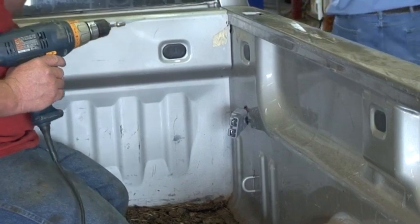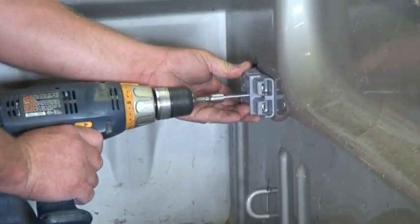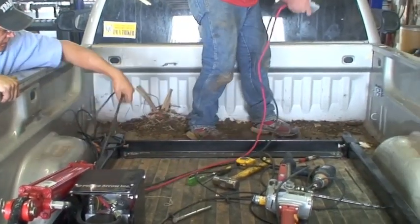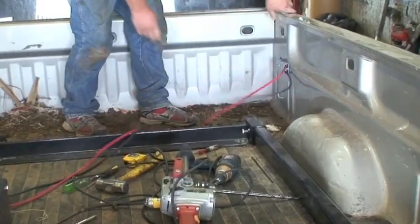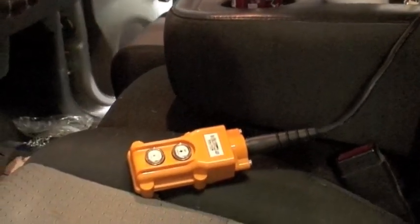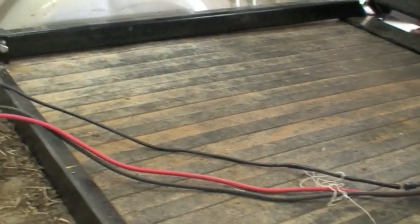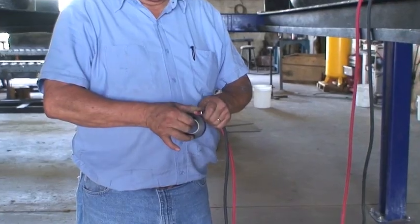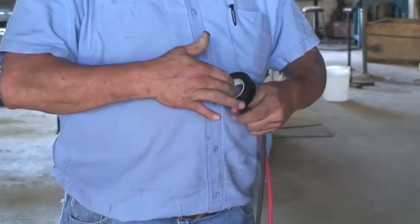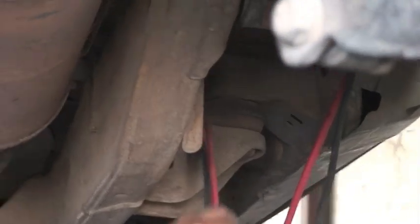Feed the electrical cables through the plastic grommet supplied in the kit. You can use the self-drilling and self-tapping screws supplied with the kit to fasten the gray connector to the side of your bed. The remote control has a fifteen-foot cord, already wired onto the bail spike. Run that around through the passenger door. Sort the cables out, make sure they don't have any knots or twists, pull them out straight, and tape the two ends together to make this much easier.